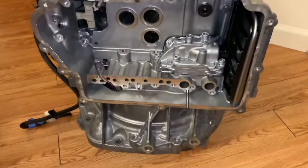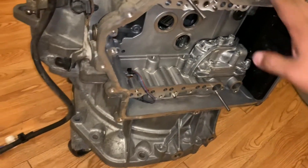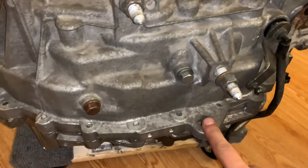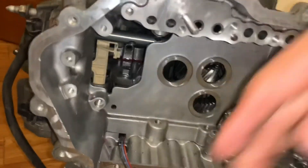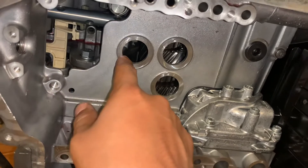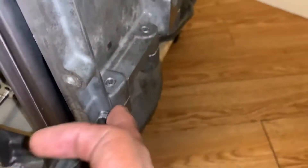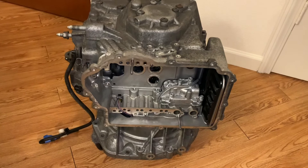That's it for this video. For the next one, we're going to add the valve body — the mechatronic unit — onto the transmission, and also all the other remaining parts. This was a bit of a struggle to assemble. One important note: be careful with the shift forks. Don't use force to push it down, because you need to align the plastic shift fork and the others inside. You don't want those to break — you want them to line up with the holes so everything sits perfectly before you start tightening the bolts.